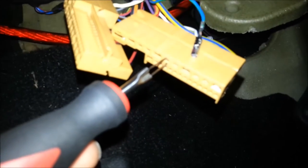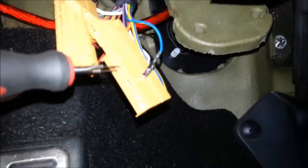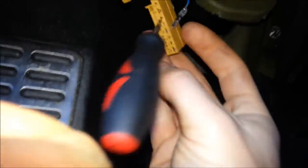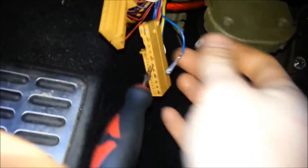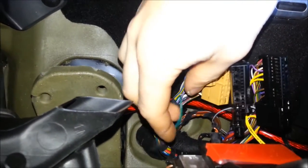It's going to be hard to see, but you pop the tool in. If you have two sewing needles you can do this — I'm using an actual probe that's meant for it. Some people use two needles. I just popped out the blue-green wire. See how there are two offset holes? You just push it in there and then slide the wire out. I've already taped up this wire.